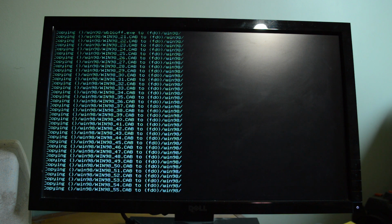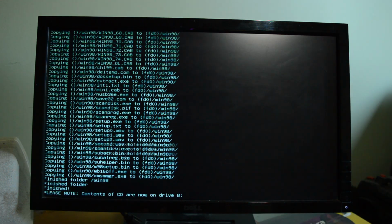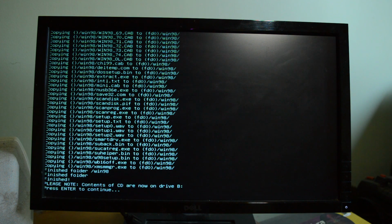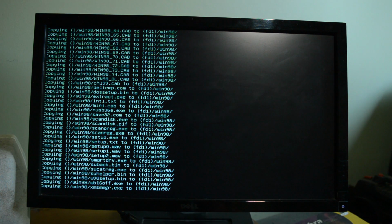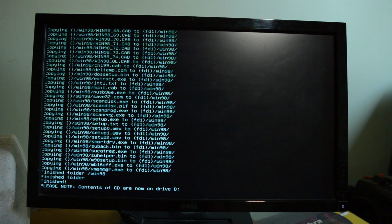The thin client booted right up and I told Easy2Boot to load the Windows 98 image. This took a while to copy the RAM, but after that, it didn't work. I tried to create a slim ISO with Ultra ISO, and same result. After some digging, it turns out my Windows 98 CD image is not bootable, as it expects a boot disk. There are special directions for Easy2Boot to have it load the boot disk image with the ISO, so I tried that. And oh lovely, it worked.